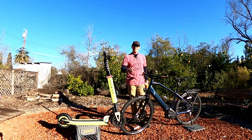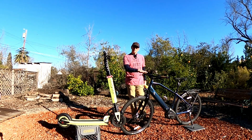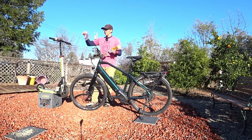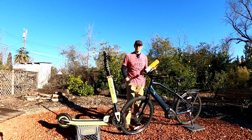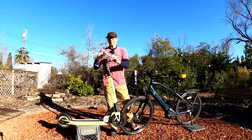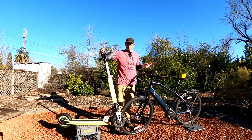I want to show you a couple of cheap and easy ways to get your bike or scooter to perform a little bit above its IP rating. My approach is a little different for bikes versus scooters. The materials: silicone caulk — I prefer the little squeeze tubes, they're much easier to handle than a caulking gun — a sandwich baggie, and plastic wrap. Real simple stuff. For the displays and throttles, I have the sandwich baggie. I'm just throwing it right over the display.